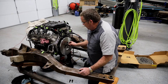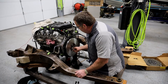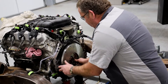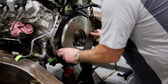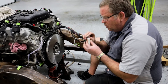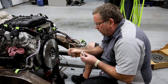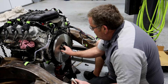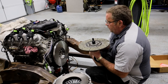We've gone ahead and set this flywheel up and lined up the bolt holes. I'm going to take my bolts and run them in temporarily, just to make sure that they all go in like they're supposed to. Then we will come back and put threadlocker on each bolt. We'll put a little bit of this blue threadlocker on each one of these bolts, run it into place, and then torque them all down. We torque these flywheel bolts down to 75 foot-pounds, which is what they call for for the size.